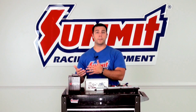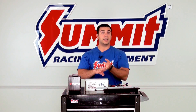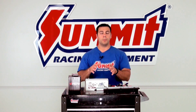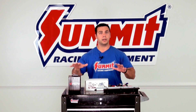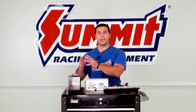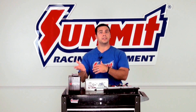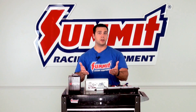In a couple of our past videos, we've talked about a lot of different things like cylinder heads, intake manifolds, as well as camshafts. If you've actually swapped out one or all three of those components, you may want to look more towards a custom tune. The reason is, some of these more aftermarket off-the-shelf components can't necessarily be tuned correctly — they don't know what style camshaft you're running, the degrees of separation, or the lift.